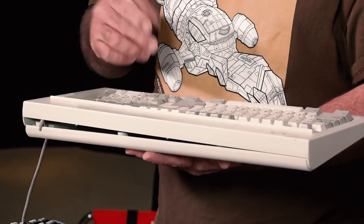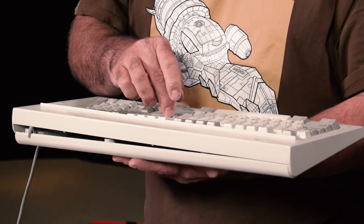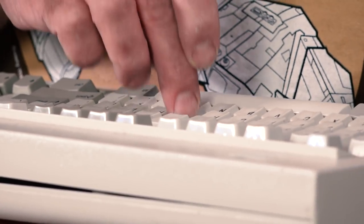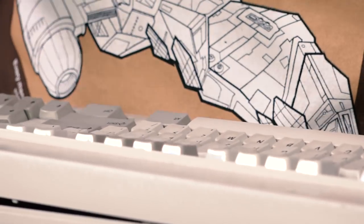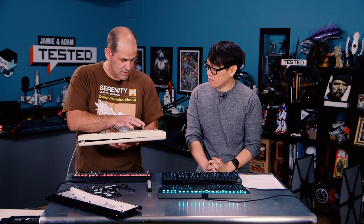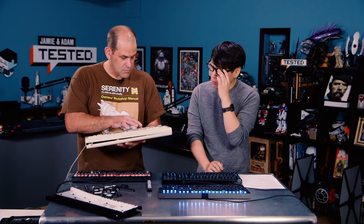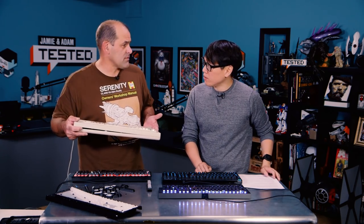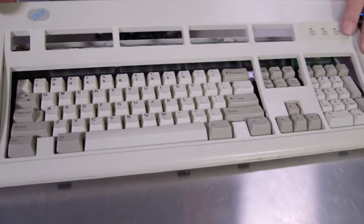There's a ratio between the distance your finger has to travel to activate the key, where you start getting resistance, how much actual resistance you're getting, and when it clicks back how fast that resets so you can press the key again quickly. For an old school IBM Model M — a buckling spring keyboard — this is where the really distinctive mechanical sound comes from. It nearly caused Patrick's wife to murder him typing 2,000 words a day on one. There's about two to two and a half millimeters of travel and people love how these keys feel for typing.